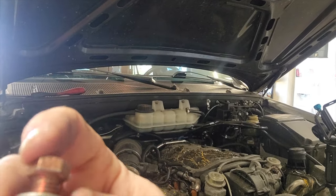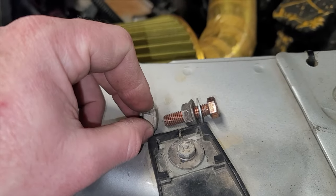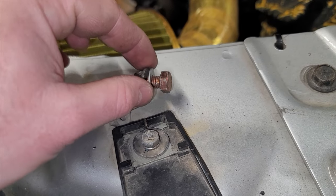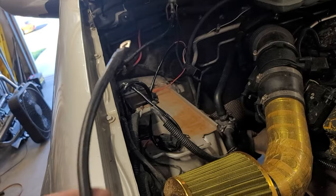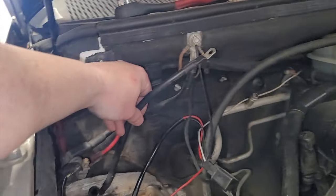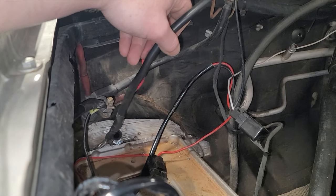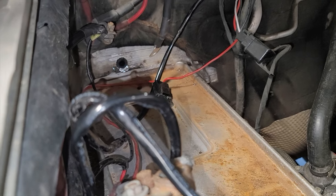This little guy from the spare parts bin is going to go through the firewall, get tightened up with a nut, and then all the grounds can go straight on it and be tightened down. It's always nice keeping spare parts. I'm not going to rely on the body for ground either, because that would kind of suck. I've also got this piece of wiring I made for some sort of ground — probably an amp ground — years ago, had it stuck in the electrical drawer. I'm going to use that — it's almost the perfect length going from this dedicated ground. So we've got ground coming straight from the battery, like hooking directly to the battery without making a mess on the battery terminals. This is an effort to do it right and make it look good at the same time.